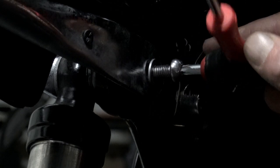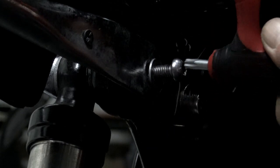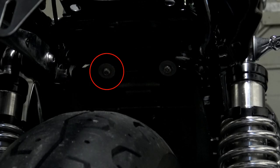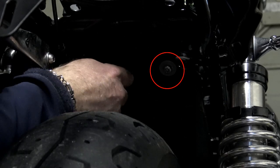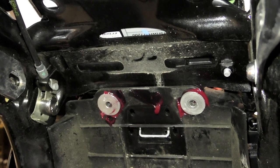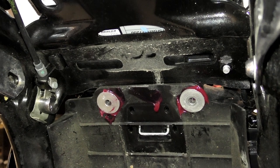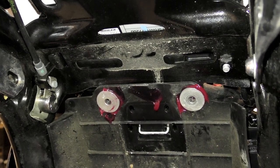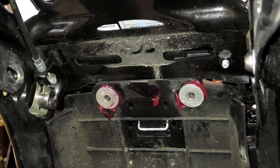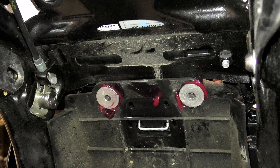In preparation for fitting the main mudguard plate and the guard that protects the seat lock, a few bits need to be removed from the bike, starting with the forward left-hand side grab rail bolt. This can be a little bit of a pain to remove because there's a lot of tension on the bolt from the grab rail, so it just takes a little patience. Once that's done, there are two bolts that go into the back of the airbox — remove these, and behind them are two top hat spacers. The instructions tell you to remove these too, but in actual fact you need them to remain where they are. As soon as you remove the bolt they'll fall out, so put a big blob of grease on the flange at the back of each one to temporarily stick them back in the hole while you go through the installation.